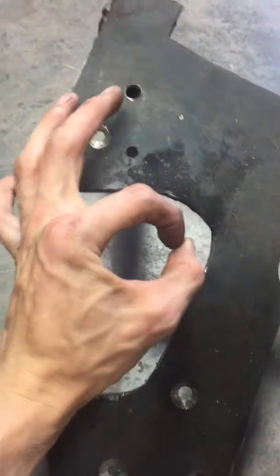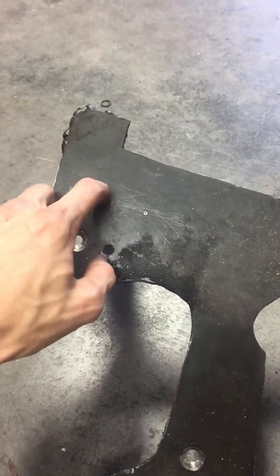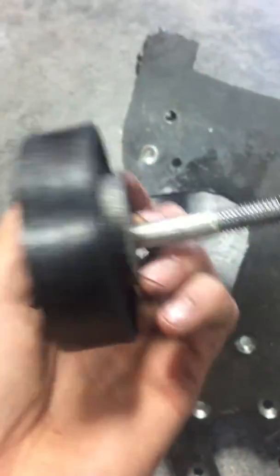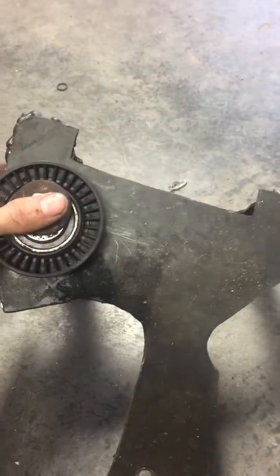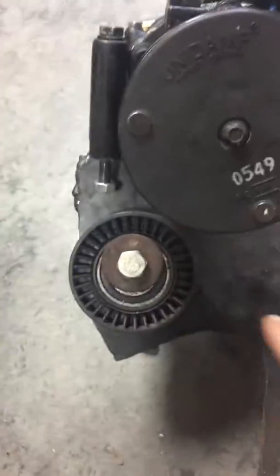The alternator sits about right there — that's where the pulley sits — and it comes up and grabs this top alternator bolt, right there. It's a pretty big bolt, uses like a 16-millimeter head. I took a stock idler pulley, cut off the back of it, ran the opposite piece through kind of like that, used a different bolt, spaced it out with some washers so that it lined up with this guy, and the idler sits kind of like that.